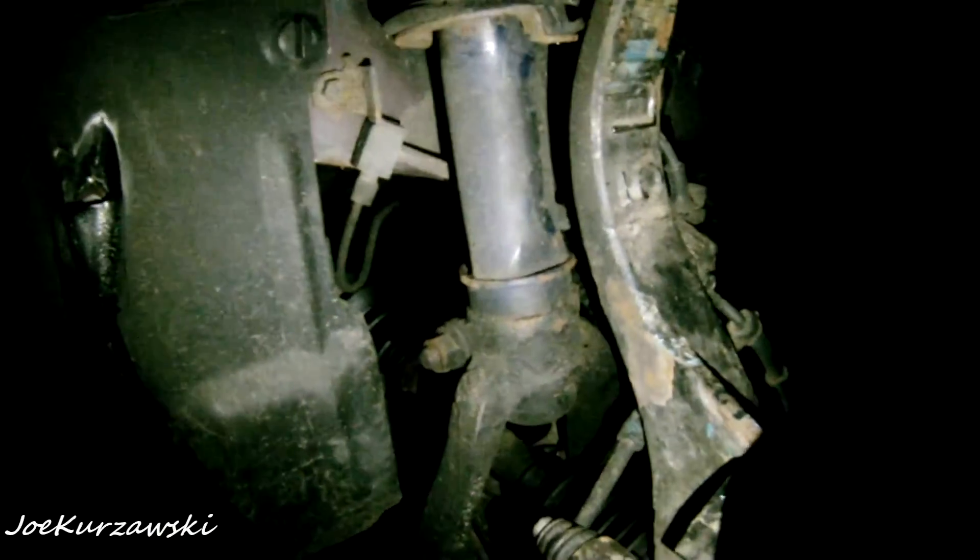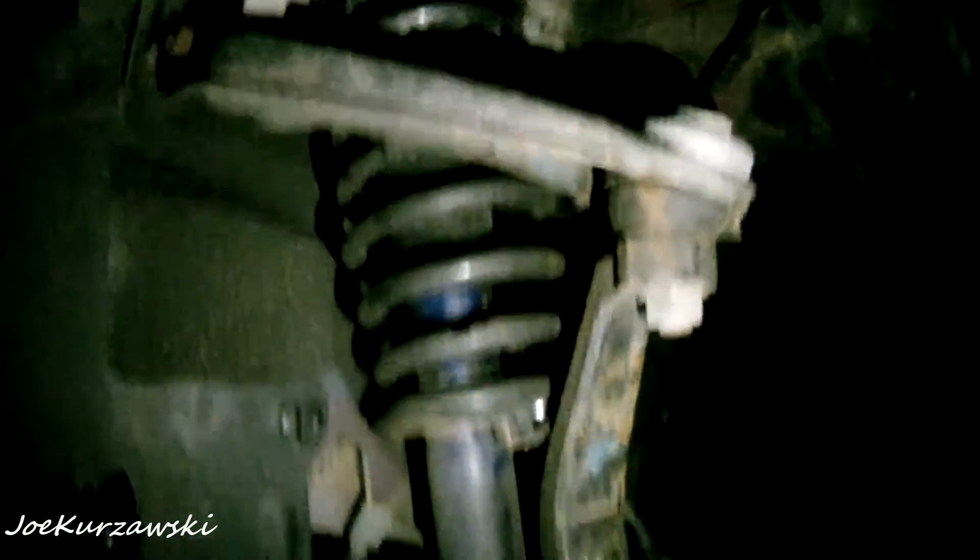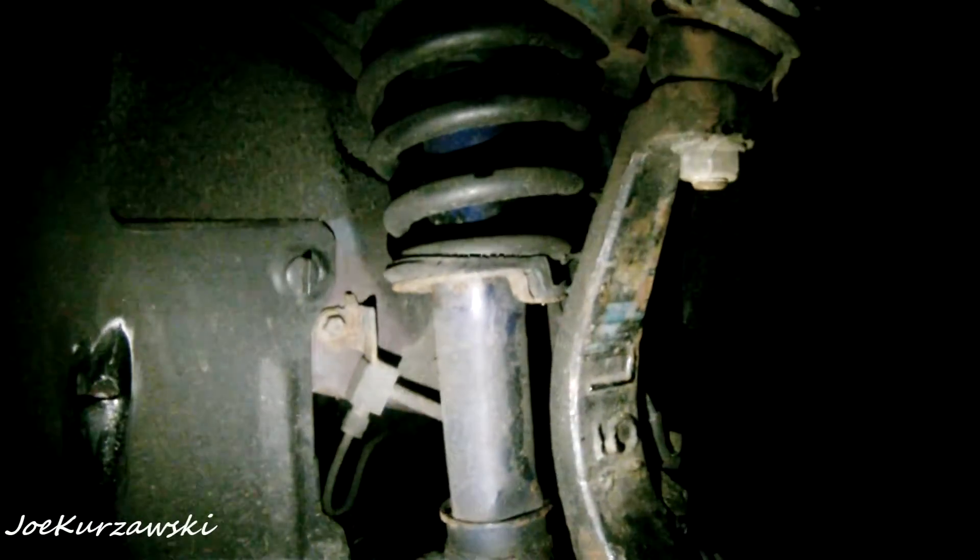Here is the inside of the Stratus front. We've got a steering knuckle, lower control arm, upper control arm, and that bracket up there. That bracket's going to stay in - it's technically like the top hat of the strut. So we have to take off that bolt there that holds the bottom of the strut, and then we're going to bolt down here that connects to the lower control arm. Then we're going to take off this bolt here to pull the spindle forward, and then take the nut off the top of the strut and it should all just kind of drop out. I will have to check clearances on the front here because the ball joint is cambered in a little bit. As long as the new coilovers are narrower or the same size, we shouldn't have any clearance issues.